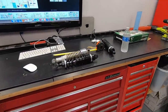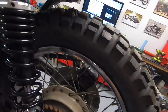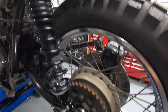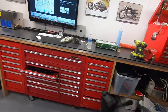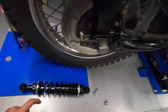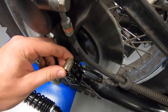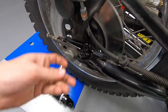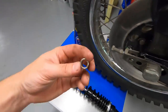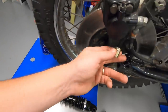Eventually when I get around to selling this bike, if somebody wants to adjust it, we can do that. It should be super quick to swap these back over. For the top, they pretty much just slide right back in — put the little lock washer on and the acorn nut. For the bottom, they give you two bushing options: a 10 and a 12 millimeter bushing to go into the little eyelet. You're going to slide this little bushing in to take up the space in the clamp so it's not just squeezing down and smashing the rubber — we want the rubber to actually act like an isolator. So you pick which bushing works best, slide it in the eyelet with a little WD-40, and it bolts right up.